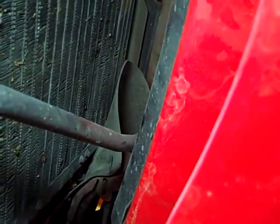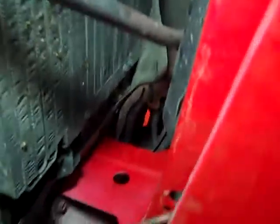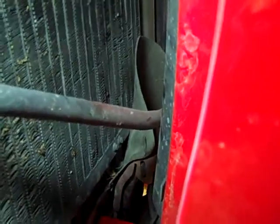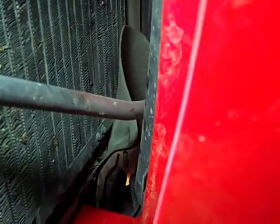So that was not put back up in place. Now let's just pull it down here. Look up a little higher — there's another rubberized flexible piece of plastic that's obviously not in place either, because it is blocking the top corner of the condenser. Rather than directing airflow through it, it is completely blocking it.